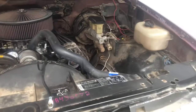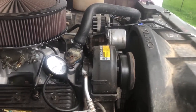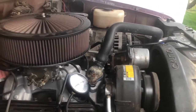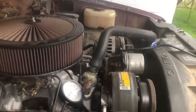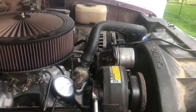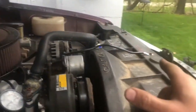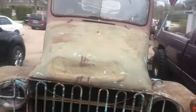Got some work done this weekend on just about everything. Got the fugly truck's charging system finally working and got her tuned up — she actually runs pretty good now. I bought a new timing light because my other one died. After getting the truck timed I still couldn't get the charging right, so I swapped alternators again and had them both tested — they both tested good. I ended up running a bunch of grounds, even ran a ground right to the core support, then ran a ground from the core support right to the battery, and that fixed the problem.